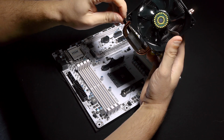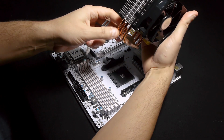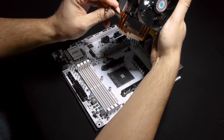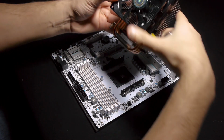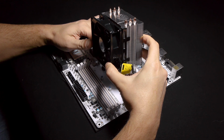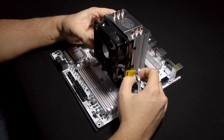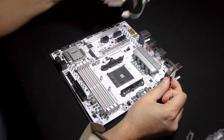And that's what I thought, but nobody was talking about it. Everybody was talking about placing it this way and saying this is the only position. Obviously, it's not true. As you can see, there are die-cast aluminum threads, canals actually, that are made exactly to be placed like this by default. So I confirm to you guys who want to buy this product that, through the heat pipe here and through the other heat pipe, this is the default position of this particular CPU cooler, and it's made by default to be mounted this way, which is the default position for most PC box configurations.